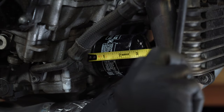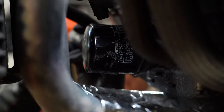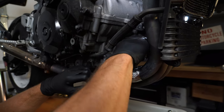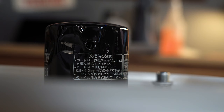Finally, if you don't have a filter wrench or large enough channel locks, you can go psycho on this sucker and stab it with a screwdriver. I am not kidding. You want to position a Phillips head screwdriver about an inch and a half from the base of the filter so you miss the threaded portion that comes off of the engine, then drive it all the way through with a hammer. Then you can use the handle of the screwdriver to twist the filter off. Gross — it worked though, we got it off. This is a brutal method and frankly it's pretty messy, so it should probably be your last resort. And following that Exxon Valdez of a mess, the most common question was how to change your oil without getting oil everywhere.